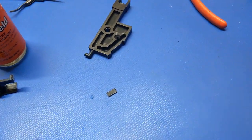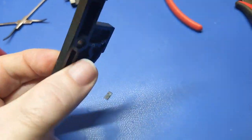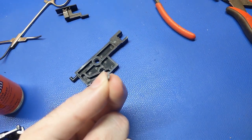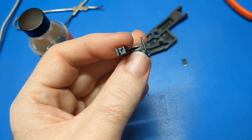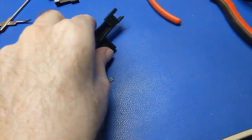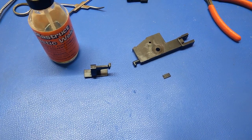Unfortunately, the bad news is, this plastic here, which I just tested it on here, is not ABS, because that's where this came from. I don't know if this is polystyrene or what kind of plastic this is, but this is not ABS. Because that's why it didn't look like it actually melted the end here. It just looks like a clean break. Now, this stuff is ABS, because you can see where it's melted. So that is ABS, that is not. So, can't use this stuff, even though I tried and I was thinking I could. I can't. I need to get another piece of ABS from something else to bond onto that. Huh. Wonder where I'm going to find something like that.